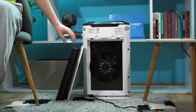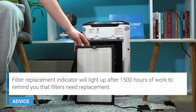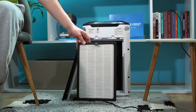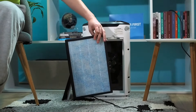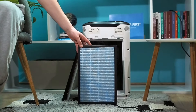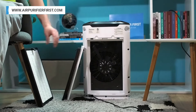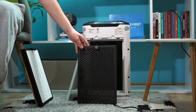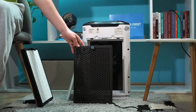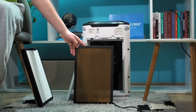The Ultra filter is the main filter and contains a pre-filter. The pre-filter is used to prolong the lifetime of other filters by removing significant pollutants. After the pre-filter comes the HEPA filter, which removes 99.97% of airborne particles. The anti-microbial filter combats bacteria, viruses, and germs — the sterilization rate reaches 99.9%. The activated carbon filter absorbs VOCs and also removes other toxins such as formaldehyde, but the primary purpose of this filter is to remove odor. And finally, there is a cold catalyst filter which decomposes and captures ammonia, hydrogen, and other chemicals.